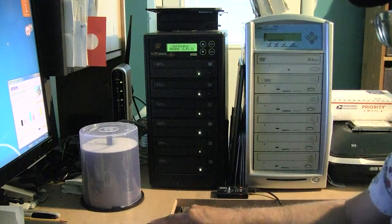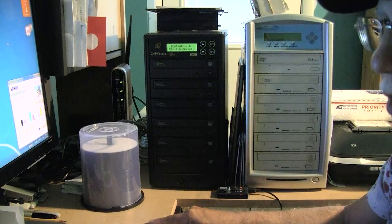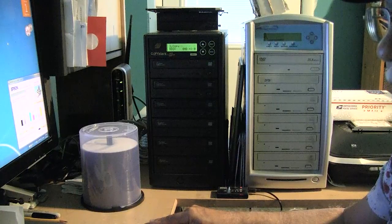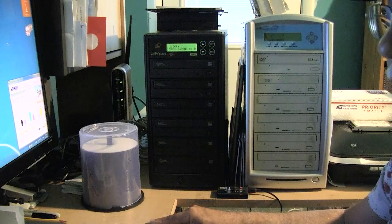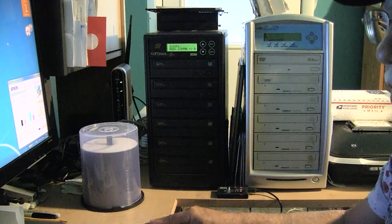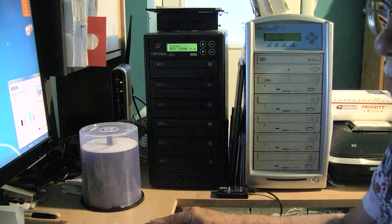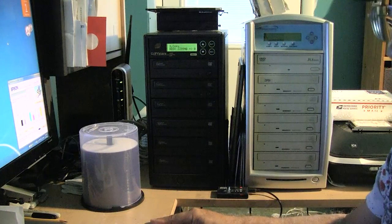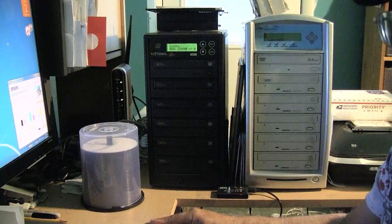While it's booting, I'll tell you I'm using a Primera Bravo 2 printer — just the basic printer, not the disc producer. On it I'm using the equivalent Lexmark 16 and number 26 cartridges. I've been able to create copies of the barcode that the printer reads, which are basically fragile decals on the original Primera carts, which are very expensive. I get the Lexmark carts from eBay for about $8–12 each instead of the almost $50-plus for the Primera carts.